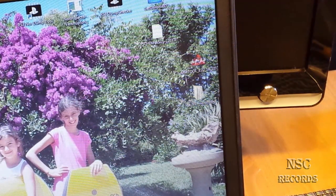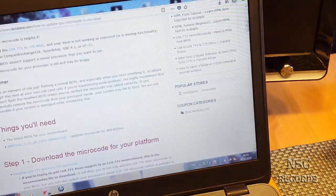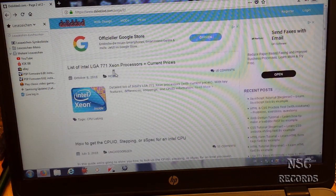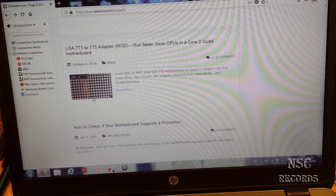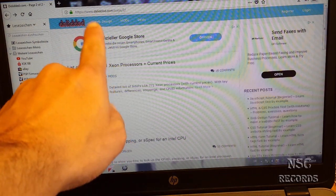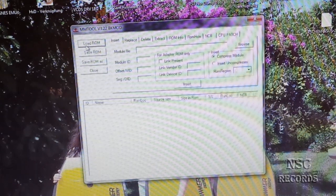The next step is you will need to download the LGA 771 socket microcodes for the Xeon processors. You can find all on the page I showed you. I've done this video for you guys so you know how this all works. But at last you should get inside and read a lot. You will have a lot of information there. Somewhere there you can download the microcodes. Everything is written — the sticker and how to put it in and all. Now let's open this tool and load the ROM. This is the BIOS which is on my desktop.